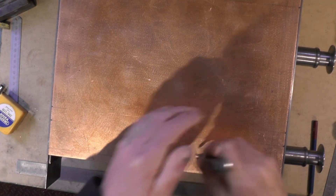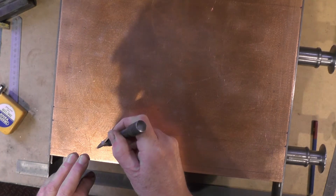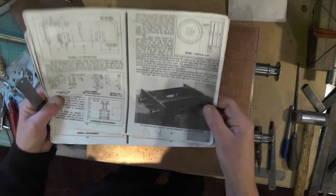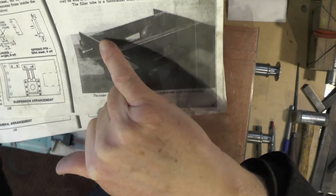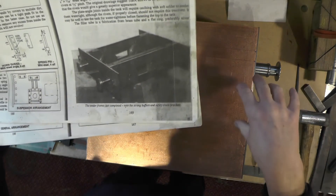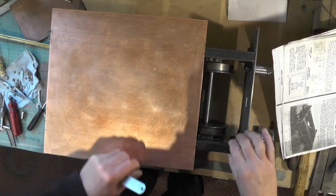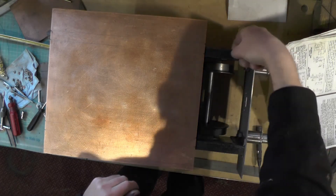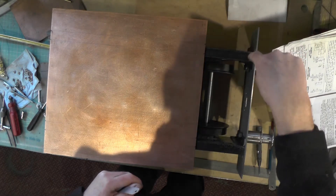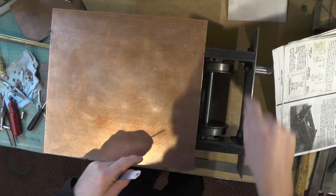I'm going to mark it — looking at how you fasten the old tank to the chassis. In the actual photograph you can see four brackets, one in each corner, that must be to hold the whole tank on. Because I've done my chassis slightly differently, I've already got an angle facing outwards instead of inwards, so I'll be drilling in each corner through the angle and I'll probably put an M5 stainless steel bolt in each corner.